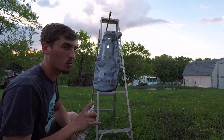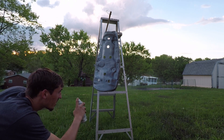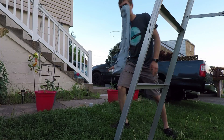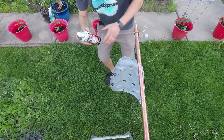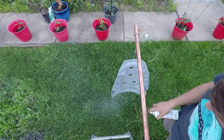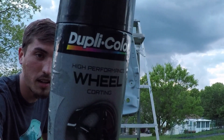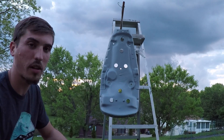Always do a few thin, light coats — that's a lot better than one thick, heavy coat. That's pretty good for a first coat; I'll let it sit for a couple minutes and hit it with another coat. Coat number two — primer looks pretty good. The primer has had about 15 minutes to set up so I'm going to hit it with some color. I'm using this gloss black wheel paint I had left over from a different project, so I've got a couple of cans I'm using up.